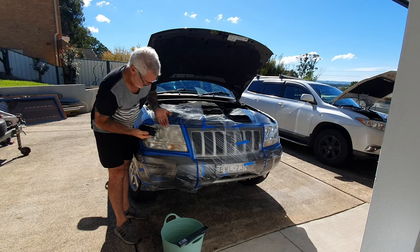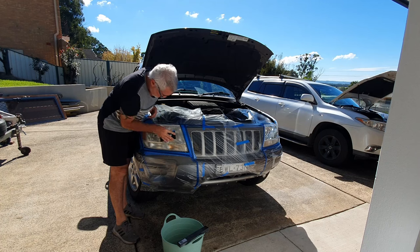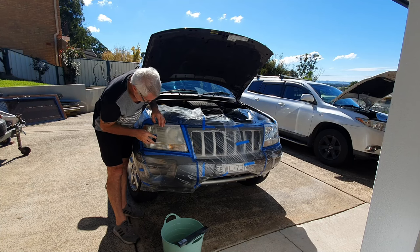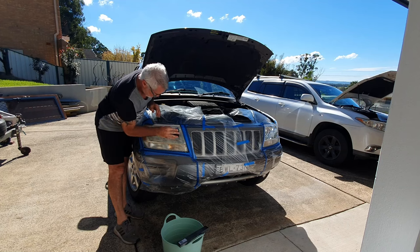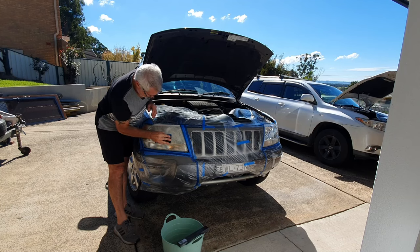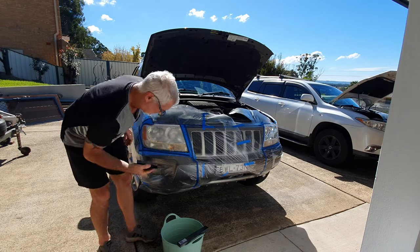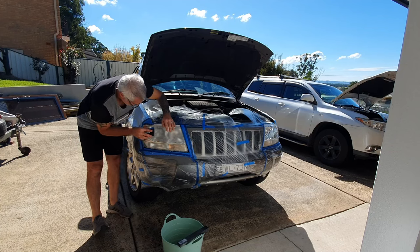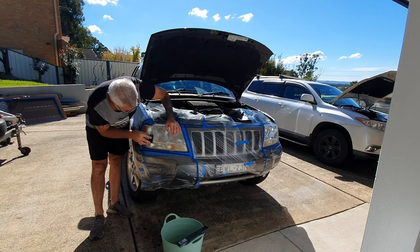You can see this cream coming off the front of the headlight. Keep it nice and flat. If you don't have a sanding block, use something flat with a bit of flex in it — bring it around and keep it flat. You can see the lens is really scratched from the sanding process now, but that's what I'm trying to achieve — knocking off all those dead high spots where the plastic had gone off.